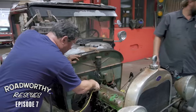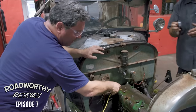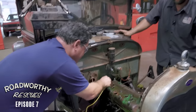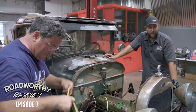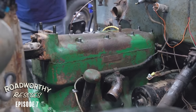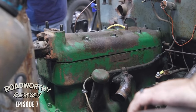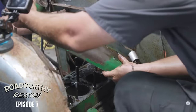What I'm going to do now is just shove a bunch of rope down in the cylinder. I've got number one and number four all the way down, number two and three are at top dead center. And then we're going to hit the starter and the head's going to bounce right off. Or break. Whichever. This is better than my option, which involved a really big torch and hammer. I'll be dipped. This is the oddest head removal I've ever seen in my life, but I'm enjoying it.